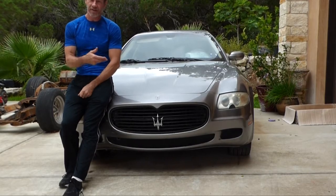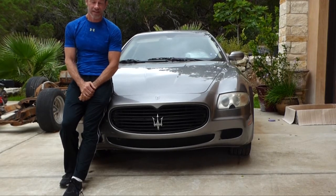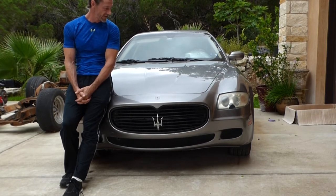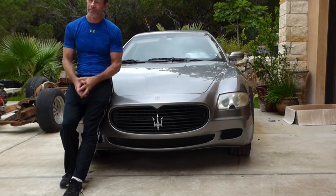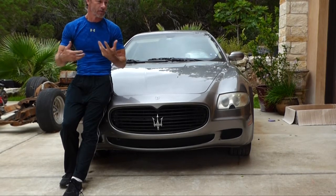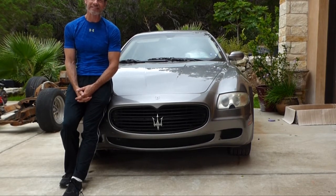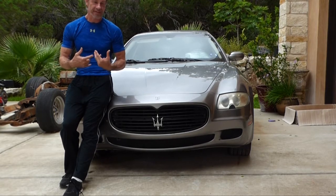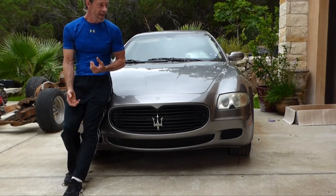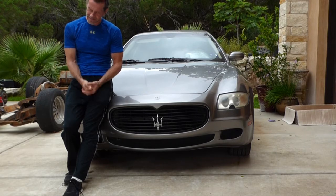Alright, so this Maserati is going to be parked here for the next couple of weeks. Yesterday I spent 3 hours working on this thing again. I built another T out of aluminum. Thinking maybe my other one was a little rough. My tig skills were better, but it still leaked. I pulled out the entire hose, which requires removal of the upper hose as well, and put it together on the bench, reinstalled it. It still leaked.